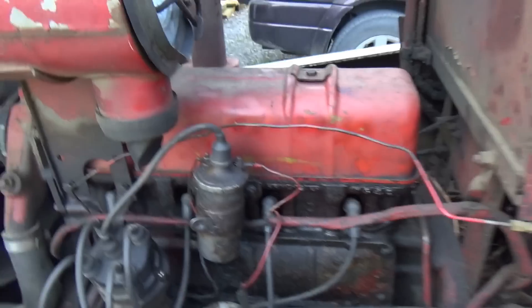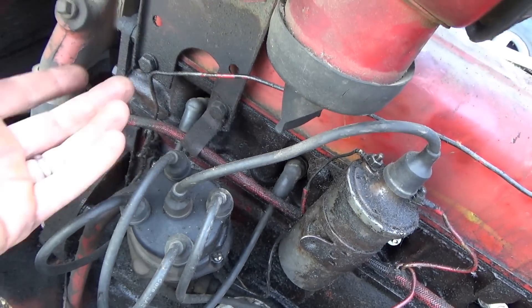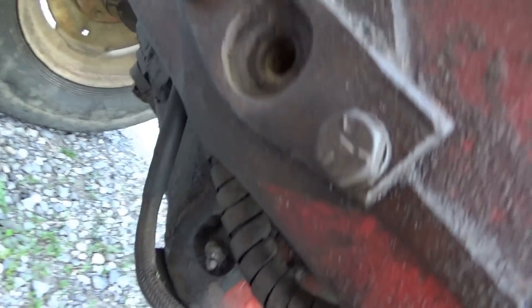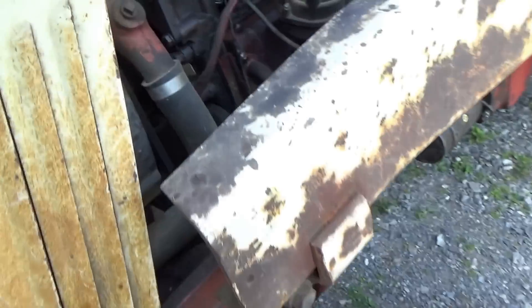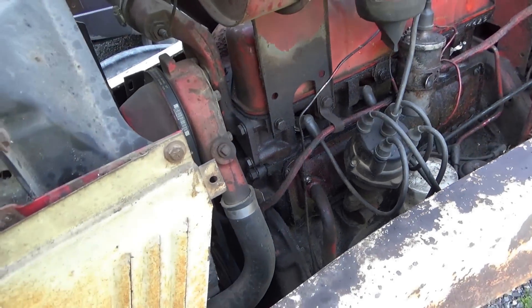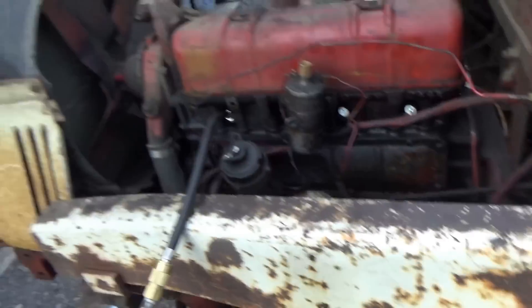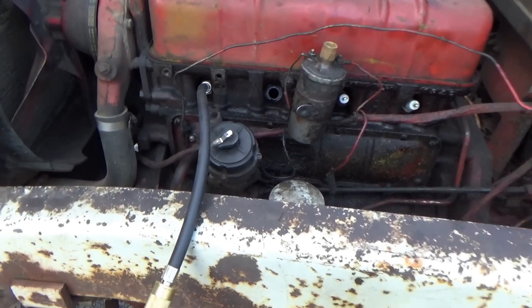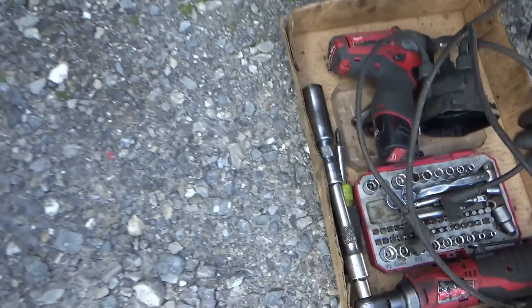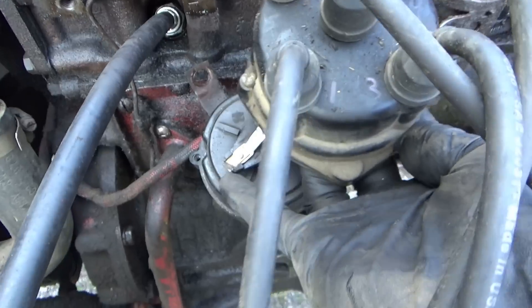Everything is accessible. Pop these plug wires off, get the plugs out, and then get cylinder 1 on TDC. I don't know if this thing has a manual crank option — how are you supposed to get to the harmonic balancer? We'll figure something out. I didn't even have the right socket for these spark plugs, the 7/8s. I had to invite the owner over and he gave me the right socket — kind of embarrassing. But we have the engine at TDC cylinder number 1. On a distributor engine you just kind of eyeball it. There's the number 1 spark plug right there, so put the pointer on there.